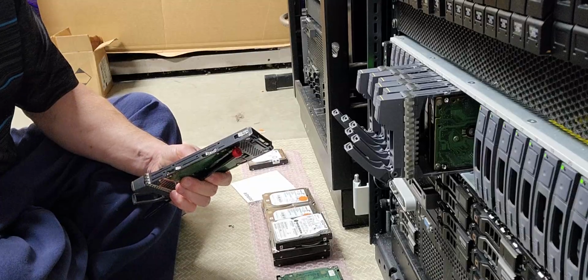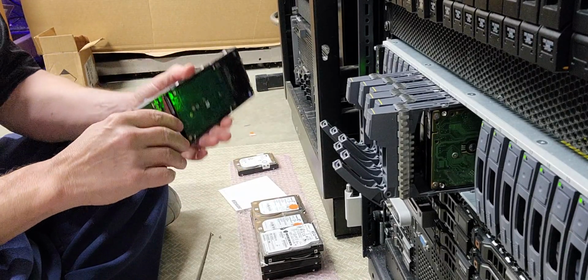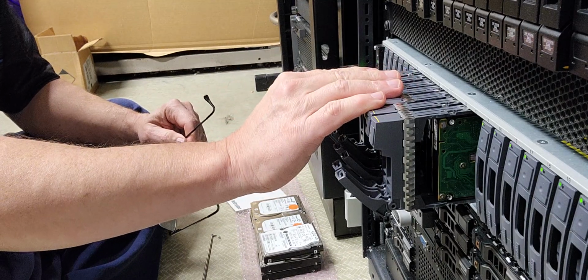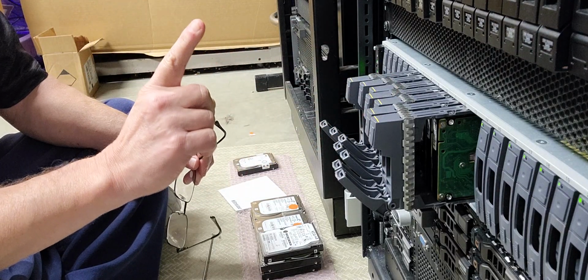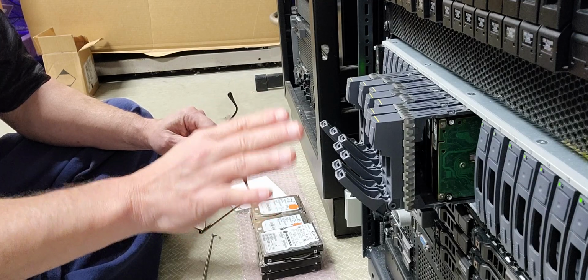You've noticed that this 720 has a lot of open bays. And I only have 2 drives up here in the front. These are all empty, and all of these are empty as well. And you're probably saying, well, hey Brad, why are you using a disk array solution down here on the bottom, when you've got all this space in the chassis? Well, for 2 reasons. One, I'm a storage architect, I'm an operations architect, I'm a DevOps director of operations, and these are HBA driven. That means host bus adapter driven. And there's a RAID controller in the 720 for RAID testing. Plus, I can double my disk capacity to allow me to do this, but when I do that, it's going to be done in a different kind of way. Now, an HBA is strictly that.